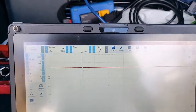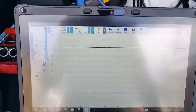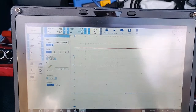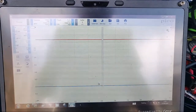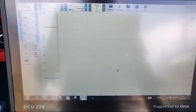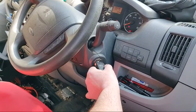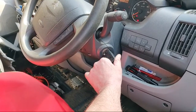I actually want to put a trigger on it, so I'm going to click on the trigger box and select a single trigger. Click on the trigger box again and you can see we've got a little yellow diamond here and the cursor's stopped. I'm going to drag it back and drag it up - it's now sat there waiting. All I'm going to do now is crank the vehicle, so round to the front, turn the ignition on and crank.